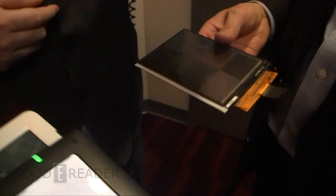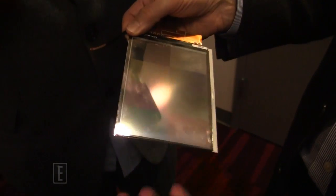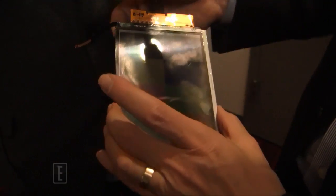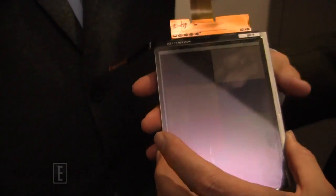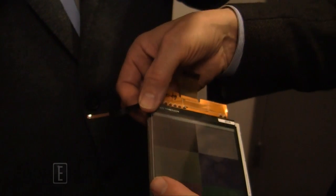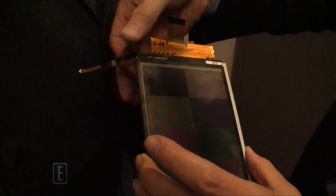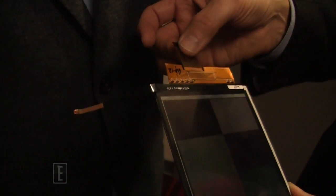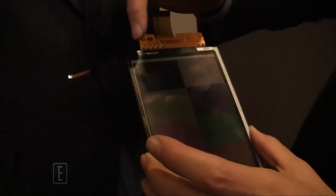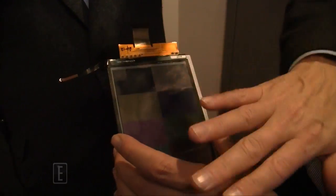I'll go into this module right here — this is just the display module itself. In Triton 2, there are a number of improvements over Triton 1. Starting with the actual ink layer, we have a bit higher contrast in the ink layer itself — the black and white ink. In the module, we've had two improvements. One is the front-light, which has two connectors: one that controls the lighting, and a second one that controls the display. This display has a number of LEDs along one of the sides that illuminate the surface.